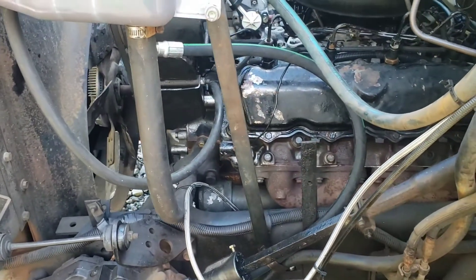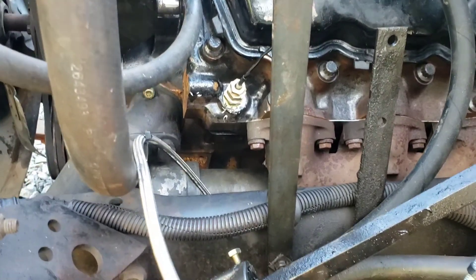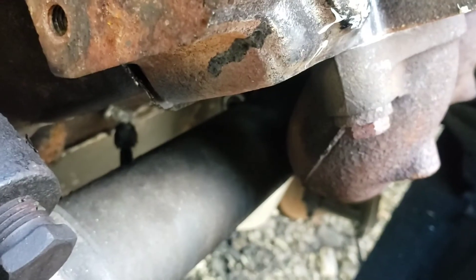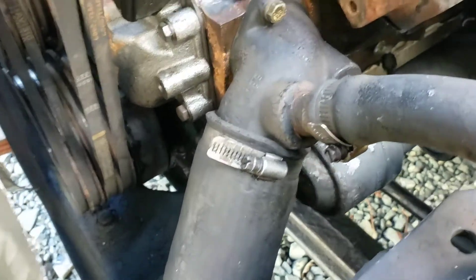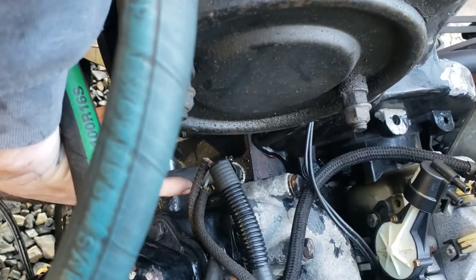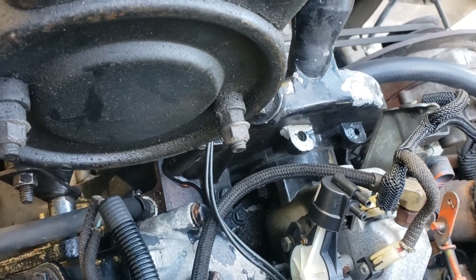Quick glimpse showing where to put in your temperature and oil sensors. Down here behind the oil cooler — you see that little fitting there, you remove that and you're able to put your oil pressure gauge in there. Coolant temperature is right there, but that'll take away your dash warning light. On Ford trucks, where this hose is going in — right there — you'll be able to put your coolant sensor in right there.